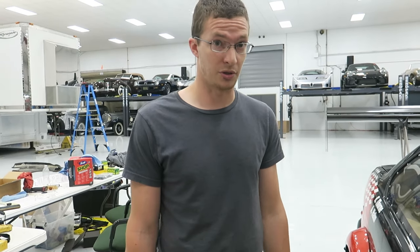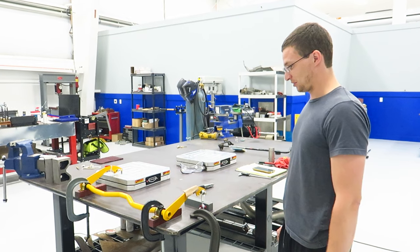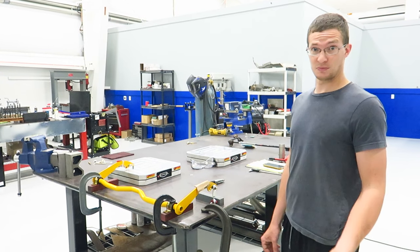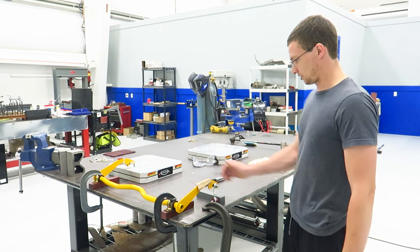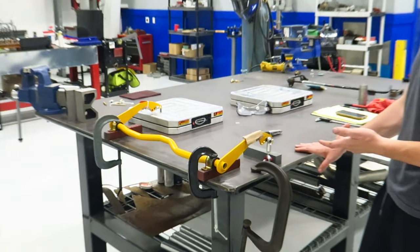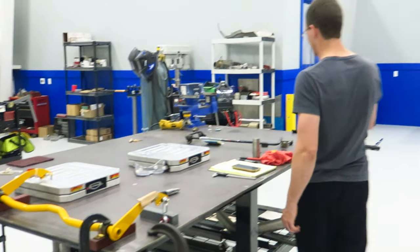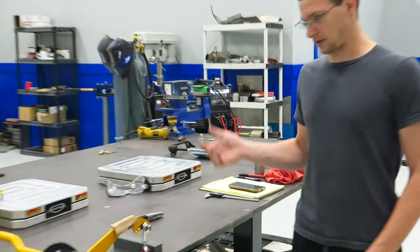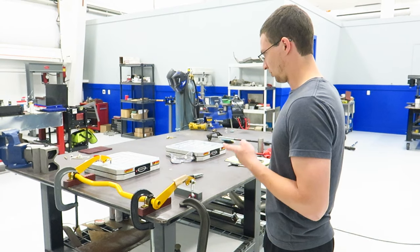Next up we'll also start on the rear sway bar for this car. We're in the fab shop now — we talked about the GTS4 having understeer, so I want to put a small rear sway bar on it. Everything on the market seemed kind of big. I talked to Ground Control and they sent over this bar — apparently their small bar — which is supposed to rate similar to the small stock rear bar, this 15mm bar I got out of the junkyard. Stock options are the 15 or I think an 18 or 19, but this looks quite a bit stiffer than they're saying.